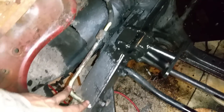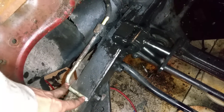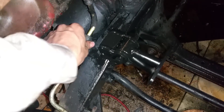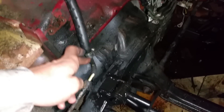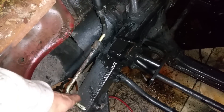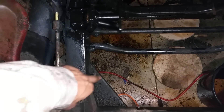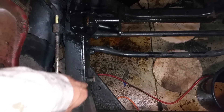I actually converted this — this is an old power steering line. So I cut it how I wanted it. It's mounted to the frame, so I like that. It's nice and secure coming out of the filter. So I converted the power steering line to a fuel line to come around the front to where the fuel pump is going to be, and I'll be able to put a line in right to the fuel pump there. That should work pretty nice.